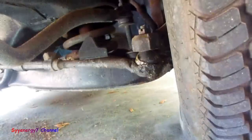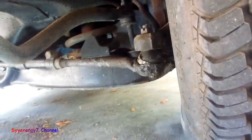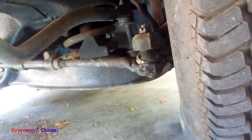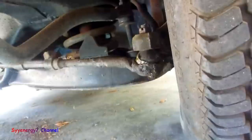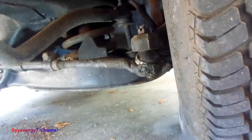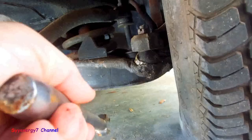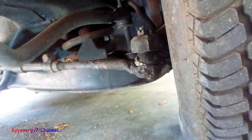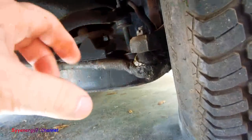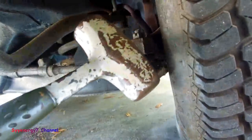The bigger the hammer, the better — and you won't damage the seal, that's the thing. Because sometimes you've got to drop suspension components and do something else. That's the way to do it. This pickle fork is absolutely totally unnecessary. I also have another ball joint separator that's the screw type, where you hook it in and screw it down — but this plain hammer works much, much faster.